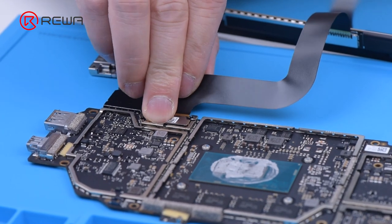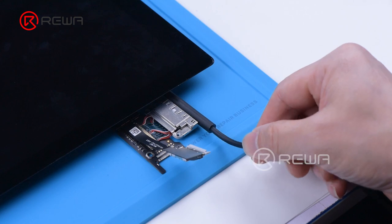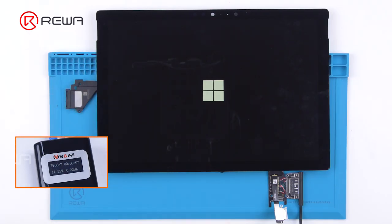As the motherboard is out, we install the display and connect the motherboard with a power cable. The problem remains the same. The current stays at 0.32 ampere and then drops.